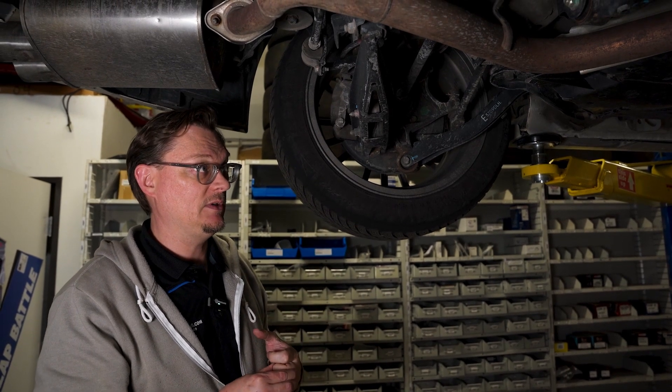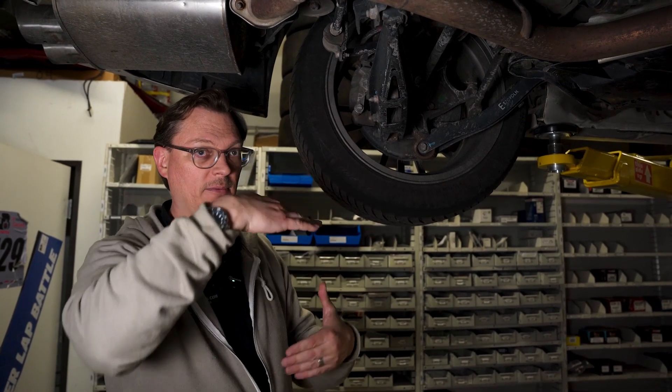That's what we saw with the GR chassis when it came out — it just seemed like it had a lot more rear grip than the GD chassis, because of the suspension design. But in terms of rally use, because of that lack of travel, all these different pieces moving in slightly different ways interfere with each other and that's what limits travel. So for off-road use when you're trying to get a lot of travel, that was an obstacle.